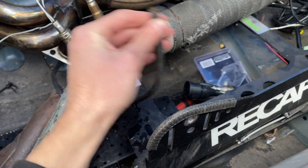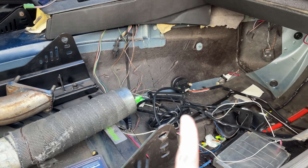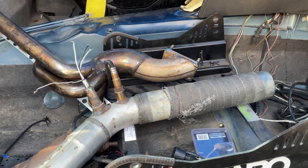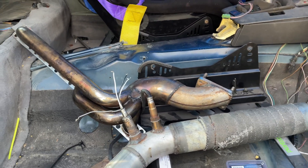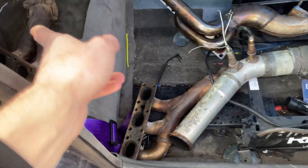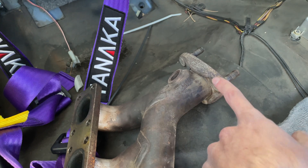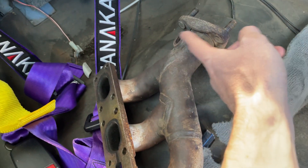Even if you try to re-solder the wideband connections, they're not going to read accurately. There's a company called 14point7.com that makes a wideband controller that's super cheap - the Bosch wideband and controller are about $125. They work really well and are even more accurate than AEM widebands. I used it on my ITB build and it ran really well. I'm going to try and get a center section for the exhaust because running open headers while auto-tuning puts the wideband too close to fresh air and it won't read well.